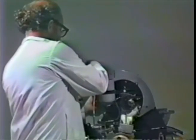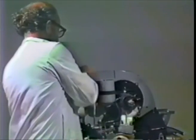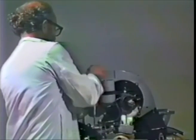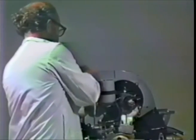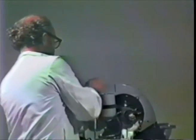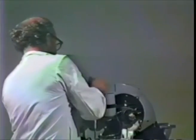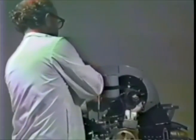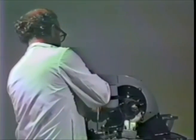That's a good time to do it, is now. Put a little bit of a bend in this, but not too much. Give it room for thermal expansion and vibration, etc. And tighten down the oil filter can. And tighten it down pretty well, too. Because when you tighten down the nut of the filter can, you have to torque on it pretty good to get it to seal the cap. That oil filter can cap is under oil pressure, which in a good engine can be 50 or 60 pounds per square inch. That cap is about 3 or 4 inches in diameter. So there's a couple of 100 pounds on that.